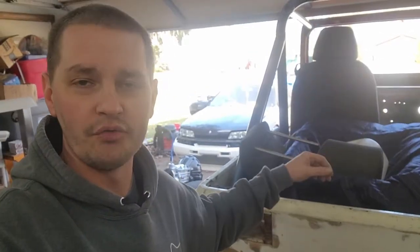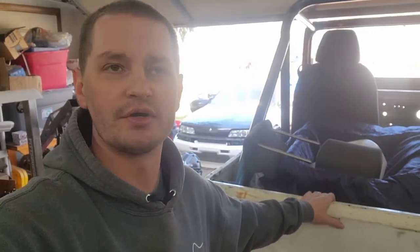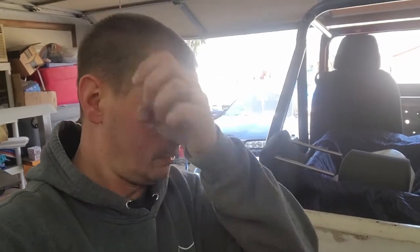The downside of all the holes in it, and fiberglass being amazing for Ohio, is that when they start drilling a whole bunch of holes in this thing, water got into the core, because this is a double wall tub, which is what makes these 4-wheel drive hardware tubs awesome. You have an exterior and an interior fiberglass layer, but we have a core in the middle that's about 3/8 to a 1/2 inch thick, and water got into this one.